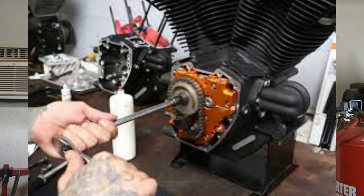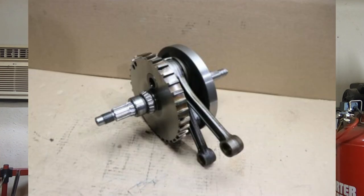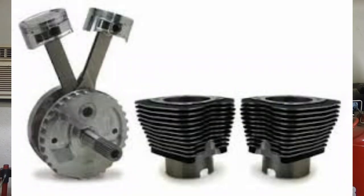Now, if you want to build an absolute bulletproof twin cam engine, the first thing you've got to do is strip this thing down and split the cases, because the number one area to start is the crankshaft. There are differences in the crankshaft — this doesn't matter if you have an 88, a 96, or a 103. If you have a '99 to 2002 88, you're already in pretty good shape down there, as those have the Timken bottom ends and those cranks were bolted together instead of pressed. The older models you're probably going to want to stroke out anyhow — if you've got an 88 torn apart, you might as well make it a 103, or go a little bigger with a 110, because that is your opportunity to put a stroker crank in it.